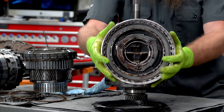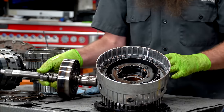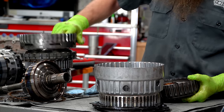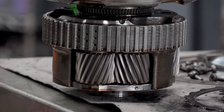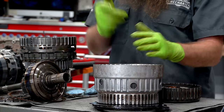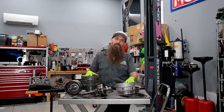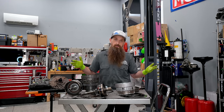Here are some other bits — we've got some gears. This is our simple planetary gear set right here. This little drum piece is pretty hot-spotted too, probably a cascading effect from the B1 brake failure. We have another clutch pack here inside of this, which is splined with this, which is splined with this, which hooks to this, and this whole unit goes into this. That, my friends, is the voodoo of an automatic transmission. Depending on what's trying to happen inside the transmission, most of these parts are either spinning, holding, or locked to another piece in the puzzle. Depending on how that is set up, you could create a 4-speed, 5-speed, 6-speed, 7-speed. My 2015 TDI Touareg is an 8-speed transmission, and we've got automatics running around with 10-speed transmissions. It's really all on how things are held or not held, allowed to spin or not spin — that's how we create however many gears the transmission has.